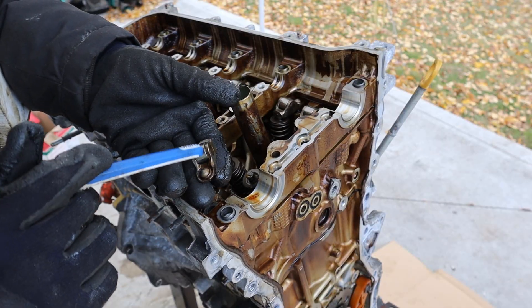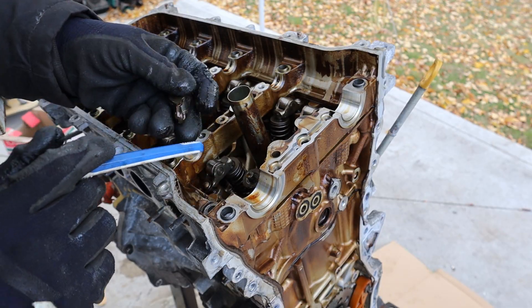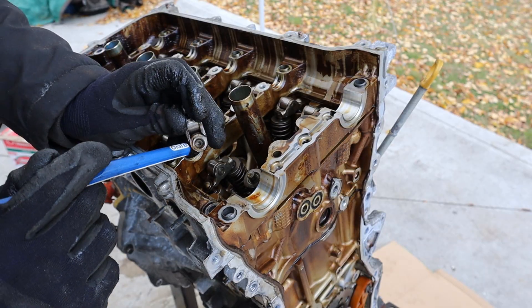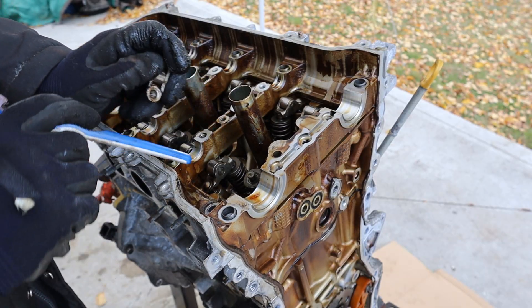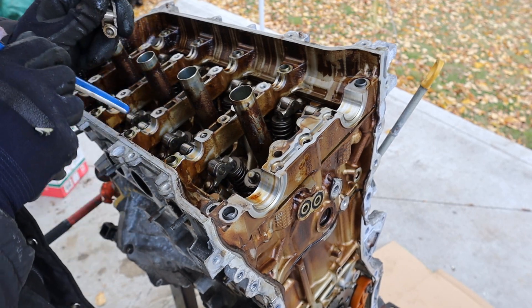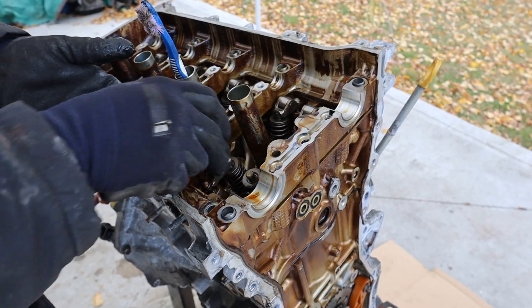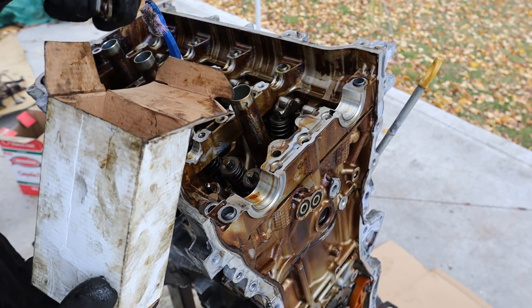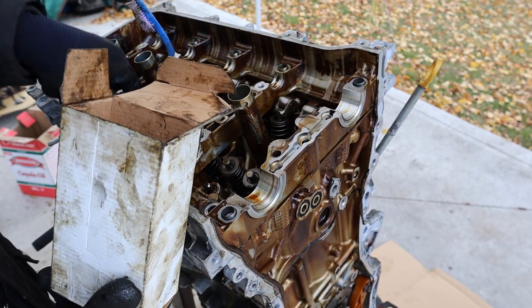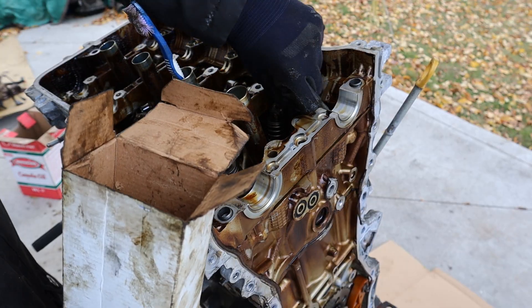Here's a better view of this little roller — this is what rolls against the camshaft and moves up and down. When this moves up and down, it pushes on that valve to move it up and down. To take up the slack between the two, you have this little cup which is secured to the hydraulic lifter, and that is pushed up by oil pressure running inside of the oil galley along the length of the head. I'll collect all of these and put them in a box — if anybody wants them let me know, you can have them as a desk ornament or conversation piece.